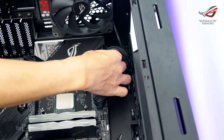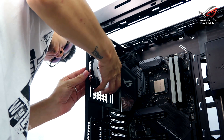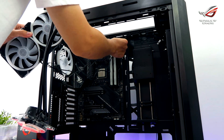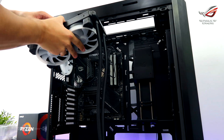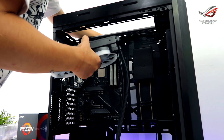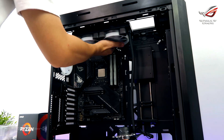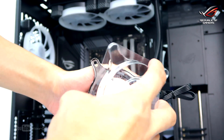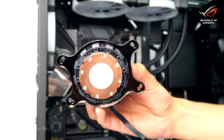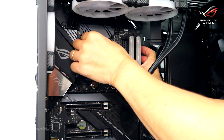You can route the EPS cable through the upper left corner of the motherboard tray. Now we can install the RGB fans — one for the rear and two for the radiator. I will be using the Cooler Vortex RGB SPB120. Always orient the cable side of the fan toward the motherboard. Cables should pass through the cutout, making cable management easier later on. Once the fans are secured with the four screws, we can install the radiator to the top mount of the case. From here you can remove the protective plastic. The ROG Strix LC240 already has pre-applied thermal compound, so mount the pump by aligning it with the previously installed standoff screws and securing it with the four thumb screws.